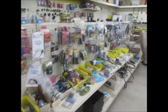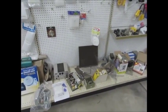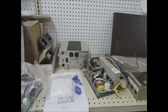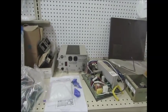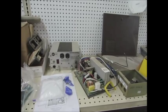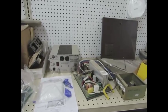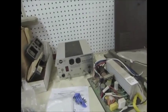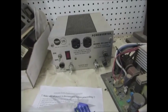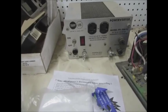Electrical — you gotta get the serial number off it. There's a big power inverter. I don't need anything that big, not for this little Shasta. That's a DC to AC inverter, frequency controlled. That means you can hook up your computer to it. Actually, that's a square wave — so you don't want to hook up a charger to it. Square wave, not sine wave.